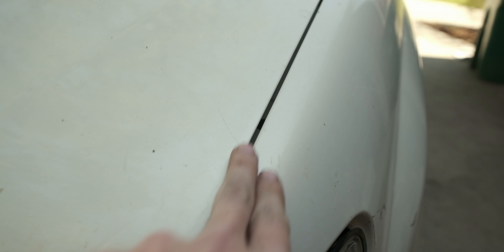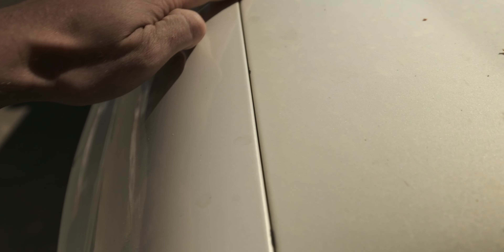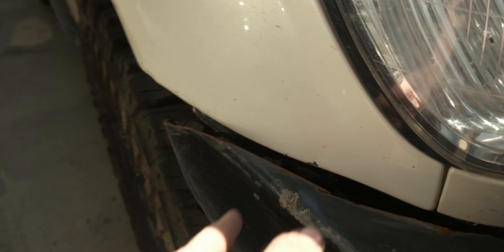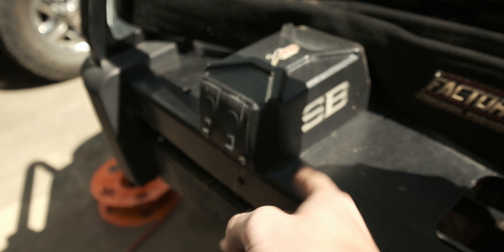When the front of the bumper gets hit, the wing smashes up into the fender and it will close the gap between your hood and fender. On this side it's a little more exaggerated — you can tell that gap is much closer than it ought to be, because this piece smashed in there. So I went ahead and removed a lot of material from the bumper just to avoid that.